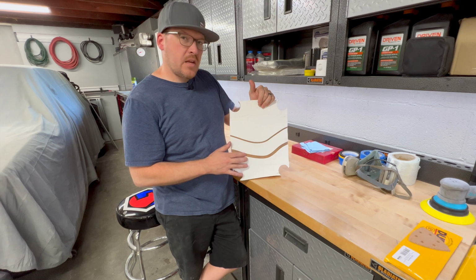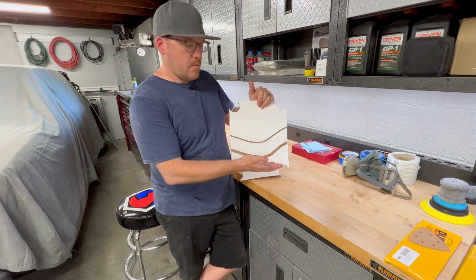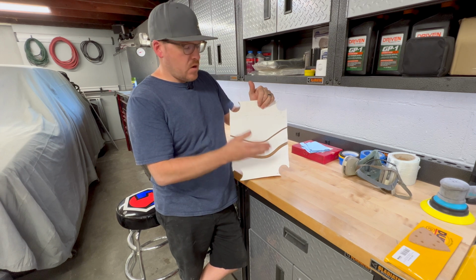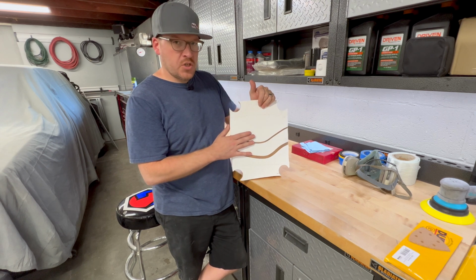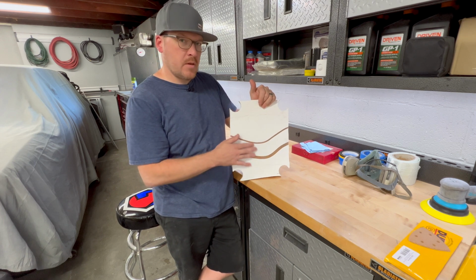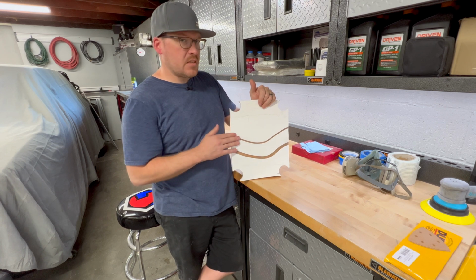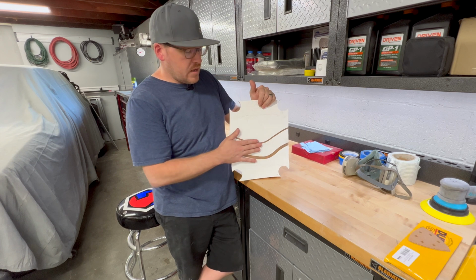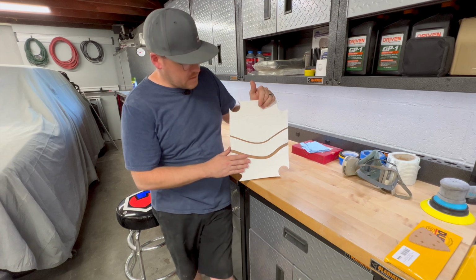So the next step that I need to do is I need to get some gel coat into these lines, so it's going to be masking all the white off in reverse of how I mask these 2 lines. So I'm going to mask on each side of the lines, mask the entire panel. I'm going to mix up some more gel coat. This time I'm going to just tint it so that way I have some color contrast to be able to see the definition in between the lines. I'm going to try to get the same 4 coats so that way I have roughly the same thickness on those lines on there. Get all this sprayed on, I'm going to let it cure up, and I'll bring you guys back and we'll see what the final product is.